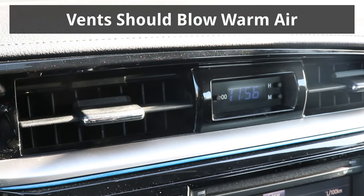And once the coolant reaches above 83 degrees Celsius and the coolant gauge is close to the middle, the thermostat valve will open and more air bubbles should be noticed in the funnel. Now I'll rev the engine up to 1800 rpm for 2 minutes to bleed the remaining air out. And once there is no more air coming out through the funnel, the engine should be turned off. For safety, make sure the engine doesn't run for too long, and do not touch the coolant in the funnel because it can get hot enough to cause serious burns.